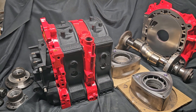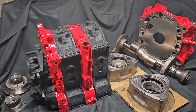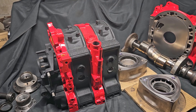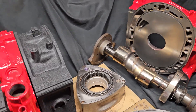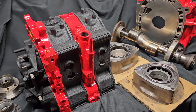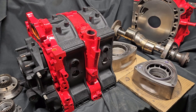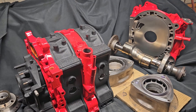Just a cool little fact — the customer who owns this car, a good friend who used to work on the race team and still helps out, is from DLW Motorsports — check it out. He was actually the winner of, I believe, the Donut Media FC3S RX-7. Check out his channel and make sure to love that brap. This little brapper's got a little more prep work and then we're going to put it together, but it's a great example of basically taking a used engine and completely refurbishing it — lapping the sides, bringing everything back into spec, replacing the rotor housings, all new bearings, some balancing, some parts, and bam — like internet magic — you're going to have an almost new race-ready half-bridge FD3S engine.